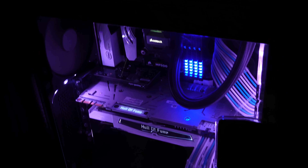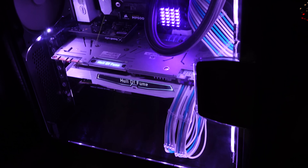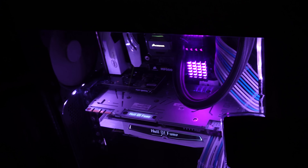We got it working by running off just the front two USB ports, disabled all the NICs, disabled all the rear USB ports, and disabled that ASMedia SATA controller — and it's stable now. I know some people are probably thinking it was the overclocks, but no, we've got this thing running at five gigahertz stable, just with the front two USB ports. It's a pretty crazy problem.